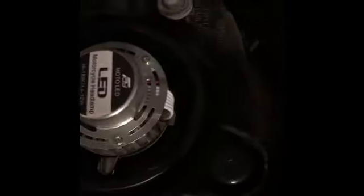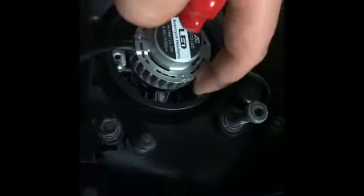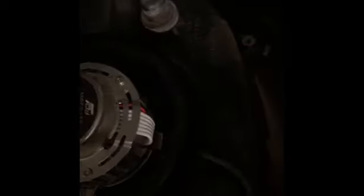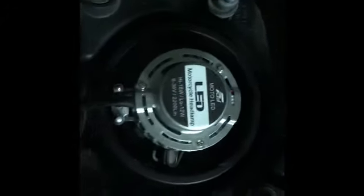That was definitely tricky getting that clip in. I had to use this skinny tool here, a wire stripper, to get a grip of that and kind of maneuver it around and clip it in. Maybe I should have taken the case out. It only took like 3 minutes to get the clip around, but I could have damaged the wiring as I was going around it, so just one thing to be careful of.